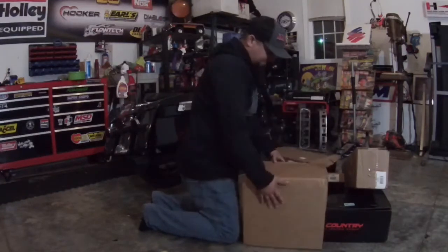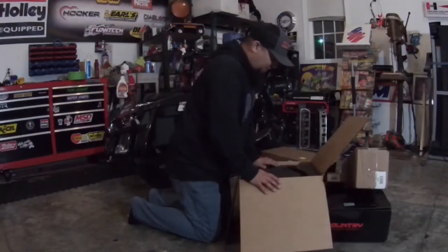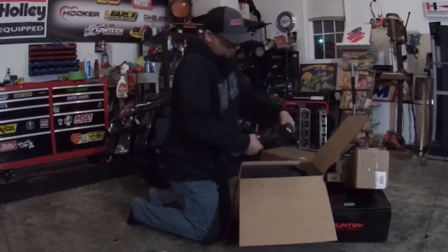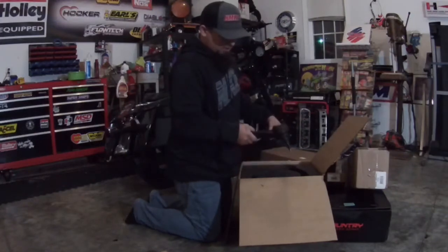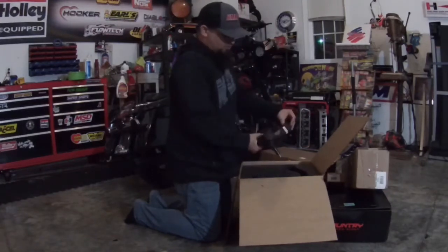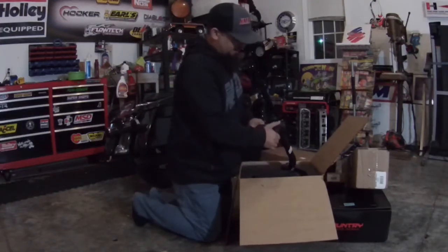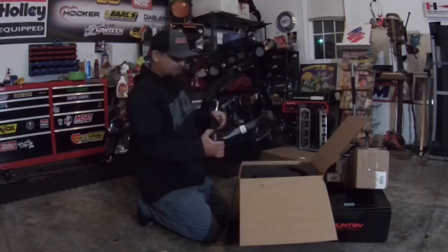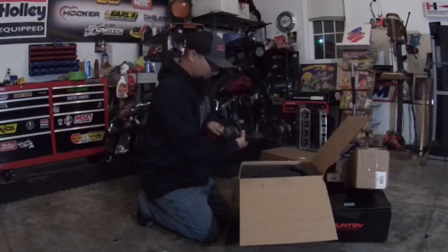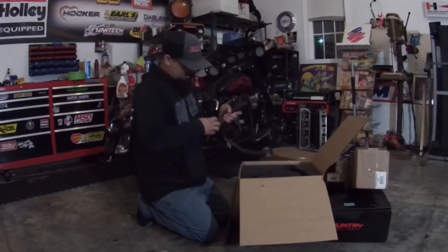Oh, I know. Sure. These are replacements for our truck. It's got about 120,000 miles on it, and the upper ball joint is completely shot. So these are upgraded forged steel upper control arms with new ball joints, and this is made for lifted trucks. Right now I have a problem with this basically binding up the ball joint due to the lift on it. This is going to correct that issue, and you got some awesome looking new control arms, and these things are heavy duty. Stout.